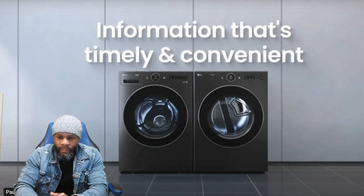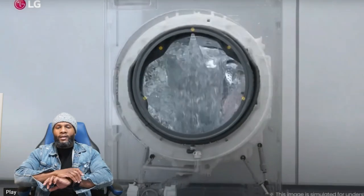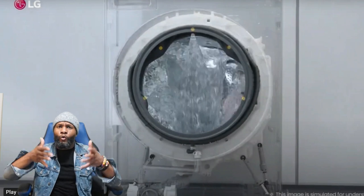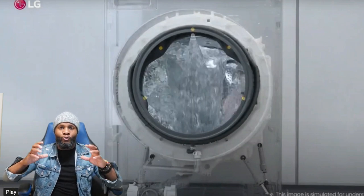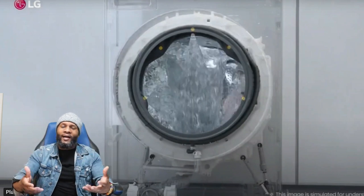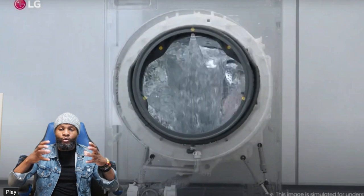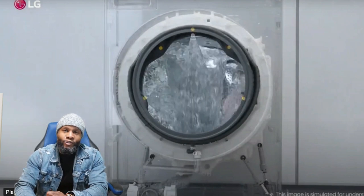TurboWash has five powerful jets — LG front loaders have a recirculation pump that allows water to pump back in using water already in the machine. This model has five different jets that shoot water on your clothes from multiple angles to really rinse and wash them out properly. Older models had two jets, one on left and one on right. Now there are five. The door has to be sealed properly for that to function — I'm not sure if this will cause more wear on the door boot seal since water is now hitting from five directions, but I'm sure they thought that through.